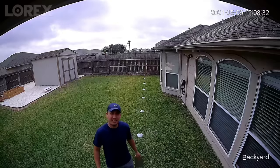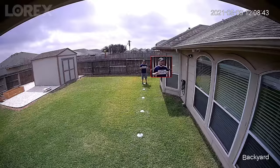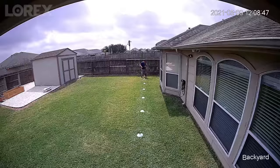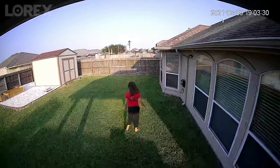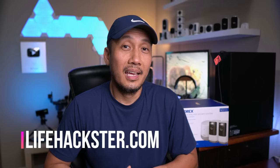Video quality is okay but uses the same type of compression as the Eufy Cam 2 and 2 Pro — at 30 feet you can see distortion and faces aren't recognizable. I'll be comparing this to the Eufy Cam 2 Pro soon. The recording length issue and custom recording time setting should be fixed by Lorex via firmware update. The PIR sensor's reliable detection distance of only 15 to 20 feet is a concern — it may be a hardware limitation. In my backyard setup, it does reliably detect every person passing through its range with no false detections. Any questions, comment below — thanks for watching.